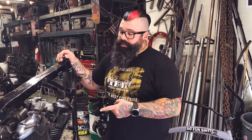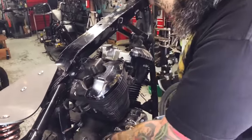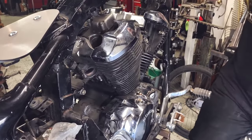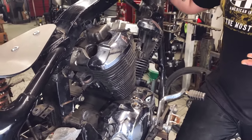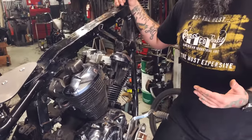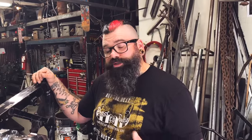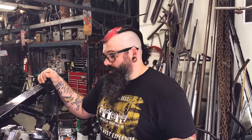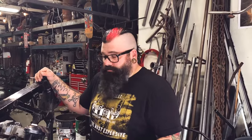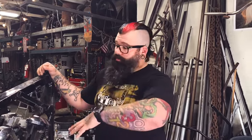So as you're putting in stacks and tuning your bike, you want to make sure not to plug that. What you're going to do instead is take a hose and run it down the back of the motor. You can run it to the ground, you can run it over your chain — there's a lot of things you can do with it, but you don't want to plug it. You're going to start getting oil in your cylinders, excessive oil, and oil blowing out of your gaskets. But as long as that remains open and free, the pressure in the crankcase can be equalized through all the power strokes of the bike.